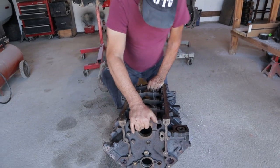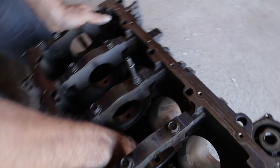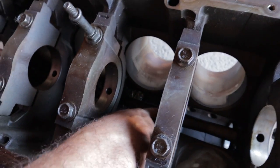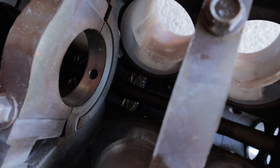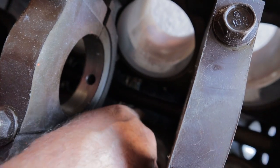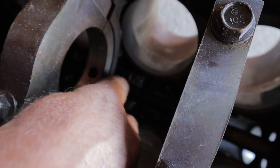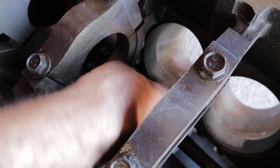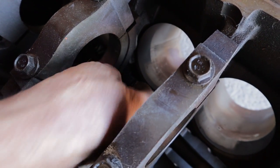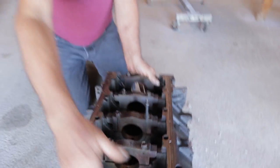If you come here and you look down into the valley of this block, you'll see that there's a main oil galley. It's cast as a tube and runs right along the bottom of the cylinder bores. Okay? Not only is the camshaft moved further away from the reciprocating assembly that's throwing oil, but we've got this tube right here, and this tube is blocking a significant amount of what gets thrown off the crankshaft, which would normally be used to just keep the cam saturated in oil. And on top of that,